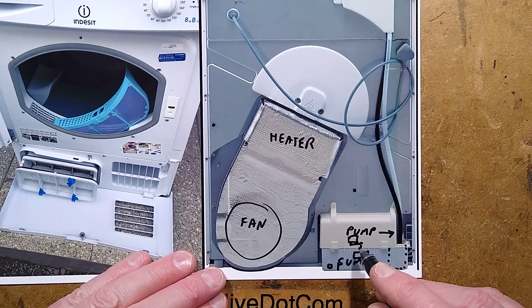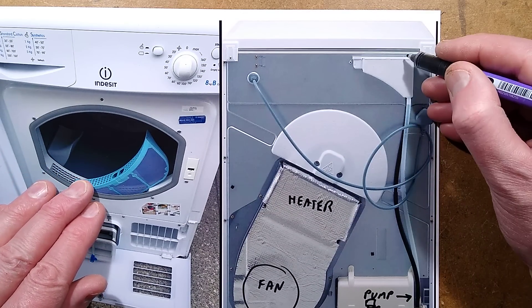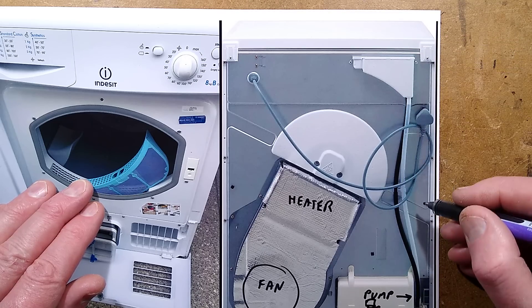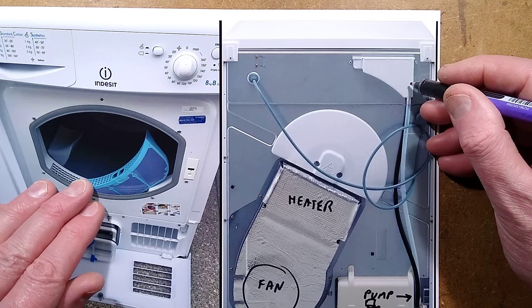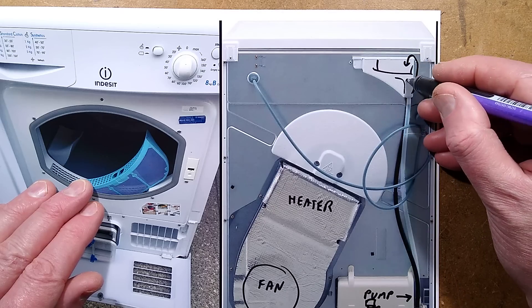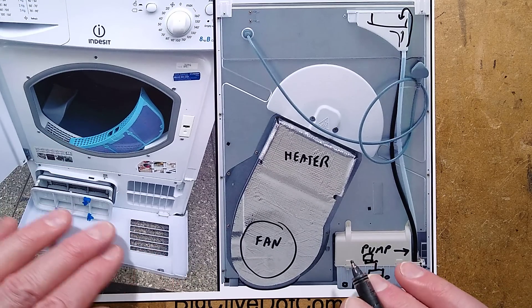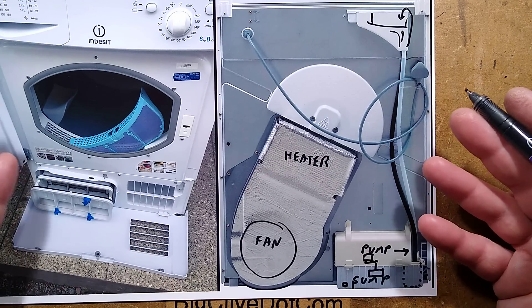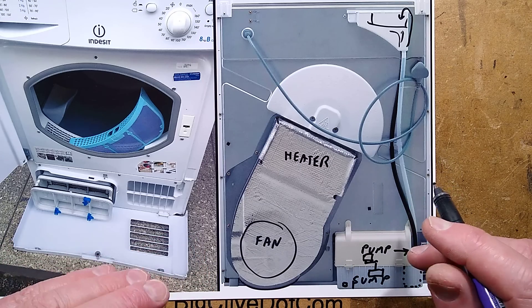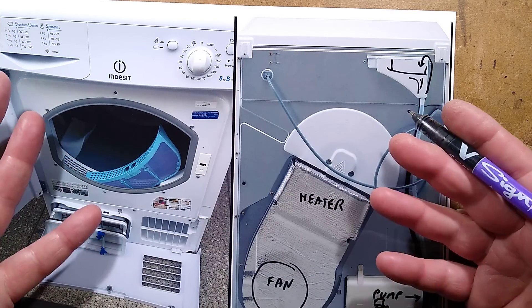When the water drawer is full and the water is pumped up but can't fill it anymore, if it overflows it comes back down. The black pipe is the one going up to the top and pouring water into the tray, and when it overflows it goes down the return pipe. That's the only point the float switch activates — and all it does is kill power to the machine. There's probably a neon indicator wired across it, and there's a little indicator on the front saying 'empty water container.'